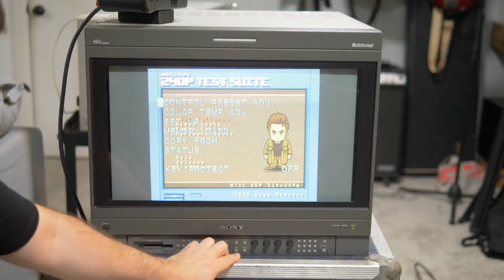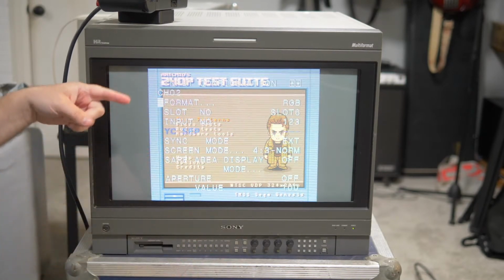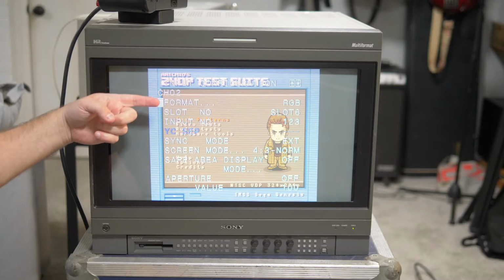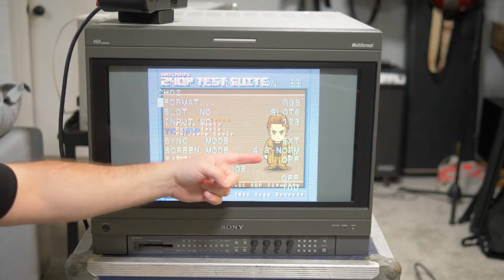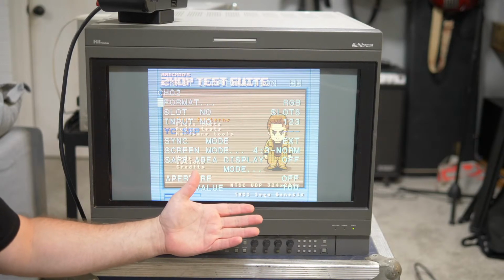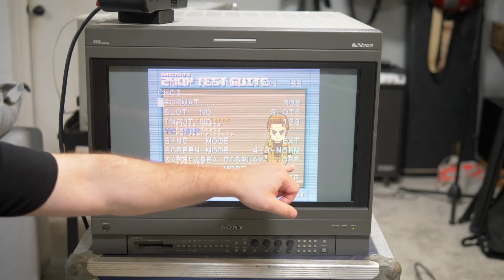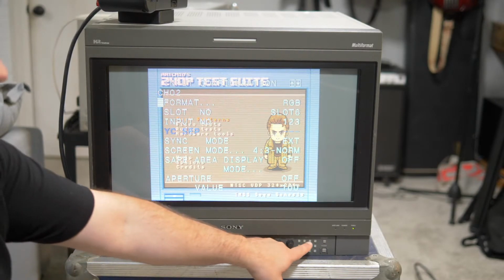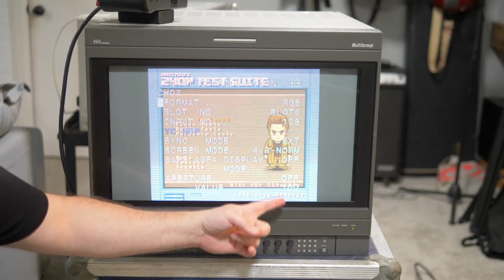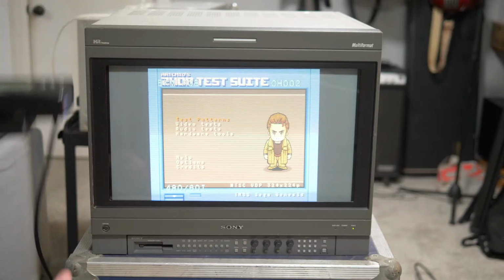So just to kind of go through again, I know it's going to be hard to see on camera, but I'm just going to do this quick. We go into Setup, Input Configuration, and it already says Channel 2. So if I press this Channel 2 button, it is configured as RGB from the right slot, the correct input numbers, external sync, which is the S. So this is the type of thing where if we were using PlayStation 2 sync on green, you would just use the sync button to switch to that. Screen mode 4:3 normal. So that's another thing I like to do is I save different inputs for 4:3 or 16:9, so I don't have to go into these menus each time. I could just press the input button. That's basically it.